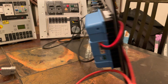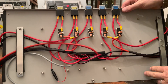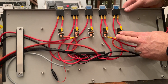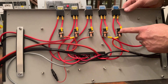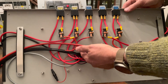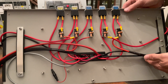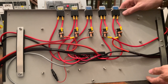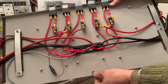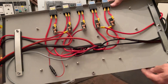Just on the back, look at the cabling. These are the switches — they're 50 amps, so plenty strong for this application — feeding up to the fuses, running down into this aperture onto the positive bus bar, and then returning through the black negative cabling to the components. These will connect onto the bracket I've made and mount via these panel-mounted rivnuts, which are really nice for mounting.